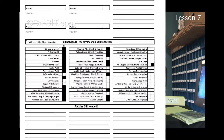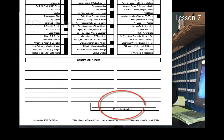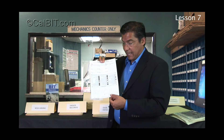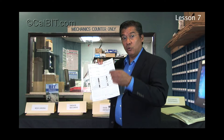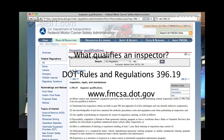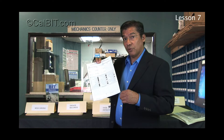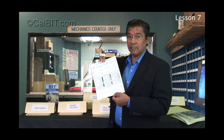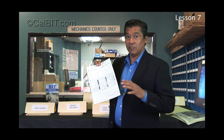The most important part of the 90-day inspection form is the signature. A mechanic must sign it, and it is your responsibility as a company to make sure the person doing your 90-day mechanical inspection is authorized — a qualified inspector. What constitutes a qualified inspector? That's where you need to know the Department of Transportation laws, because through the federal government they tell you what qualifies an inspector. When you sign this form off, it's like signing off on an airplane if you're an airplane mechanic — you're assuring that vehicle is going to be safe going down the highway. This is not something to take lightly.